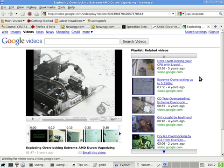In other words, your processor, which normally operates at, let's say, 2.4 gigahertz, will sense its own temperature and say, oh, I'm running really hot here. I should not be operating at 2.4 gigahertz anymore. It will clock itself down to maybe 1.2 gigahertz or even lower. So what you see is the computer getting really slow, but it's really the processor and the software component together trying to preserve itself and say, okay, I should not be operating as quickly because I cannot dissipate all the heat anymore.